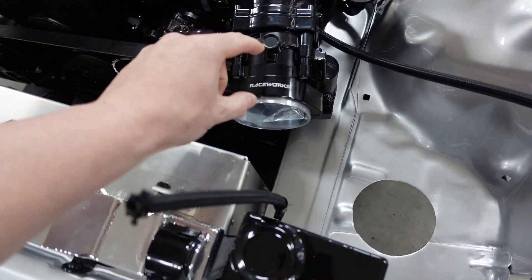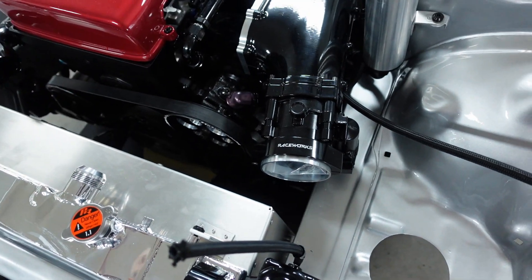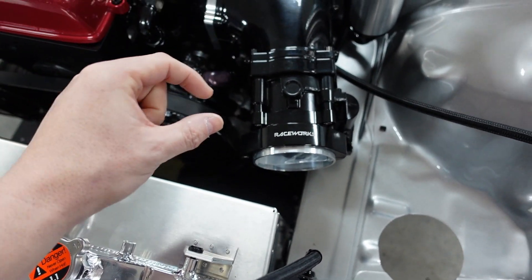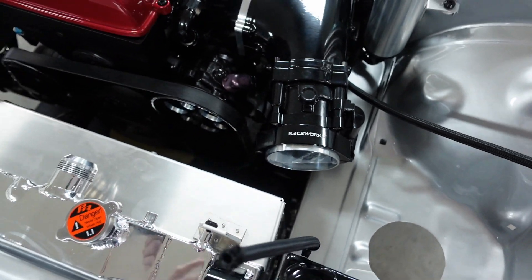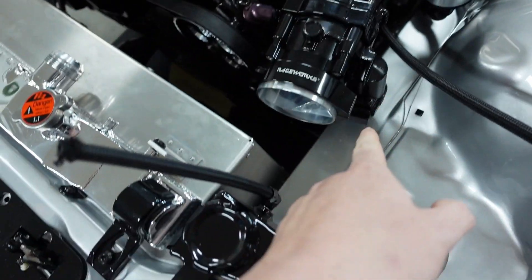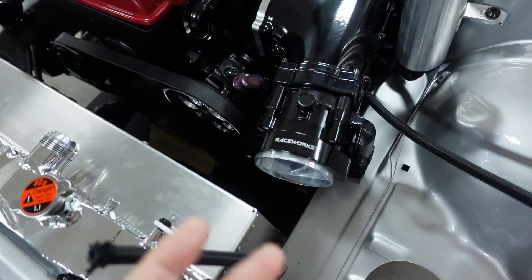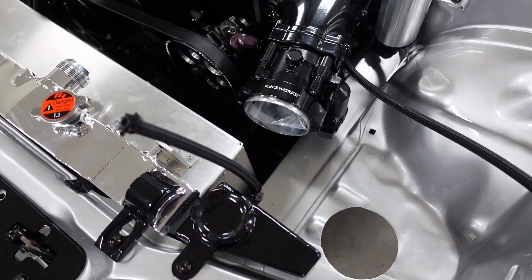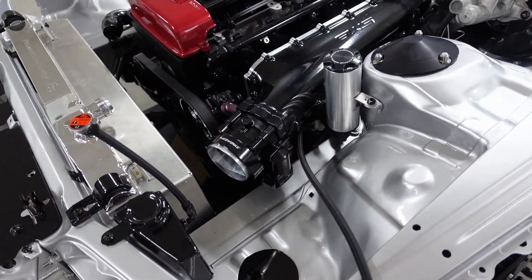Without that adapter, I could easily get a three-and-a-half inch pipe over it. Bosch throttle bodies are really thick and wide versus a Wilson or RMR, which are much thinner — that saves about another inch. Those two things together would take off two and a quarter inches. But with the shroud and the way this is designed, I'm in a bit of a predicament. I've been talking to the owner of SMS about an adapter plate that cocks it over, but even still it might look goofy. I haven't decided yet — feel free to leave suggestions.